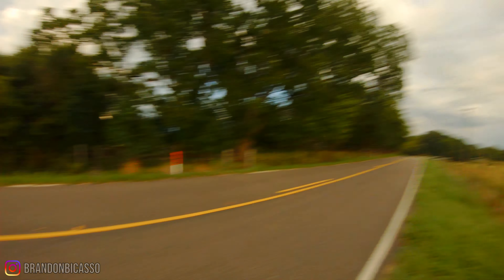Back to the exhaust — well, half of an exhaust, rather. The bike is starving from a lack of back pressure, making it more difficult to start. This exhaust started to grow on me, but there's always a better exhaust out there. I found the stage one Chief exhaust for the low — like, half off low. And this makes sense for installing it because it was made for the bike.